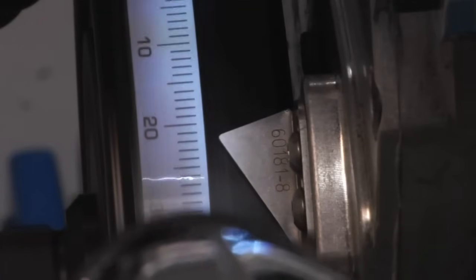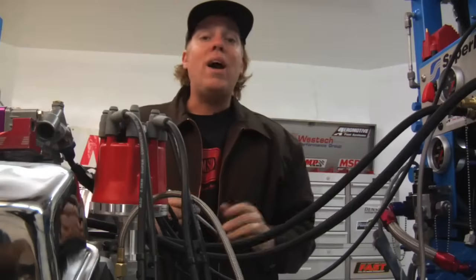Here's what Chad is seeing through the timing light. You can see the initial timing setting is about 12 degrees. Now watch as engine RPM increases — the timing advances up to about 33 or 34 degrees. It'll start to jump around up there, and that's not actually what the engine's doing; that's a result of our camera shutter speed. But you get the point that as engine RPM increases, so does timing advance.